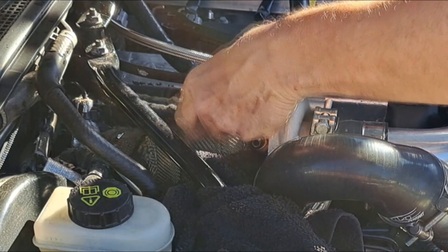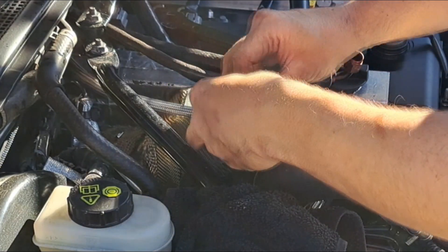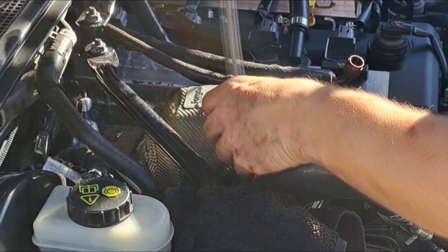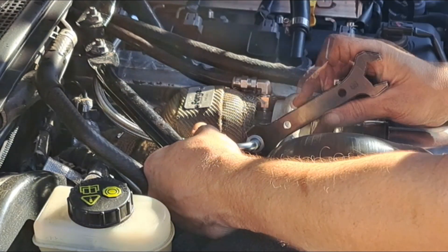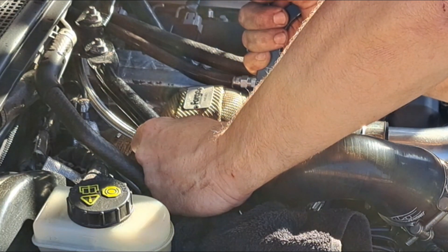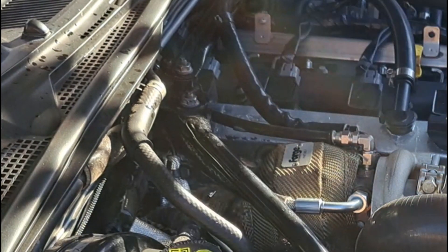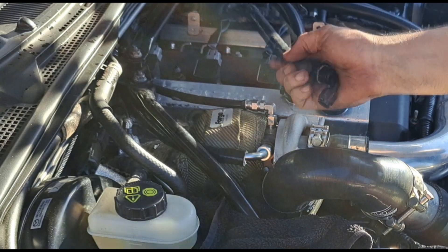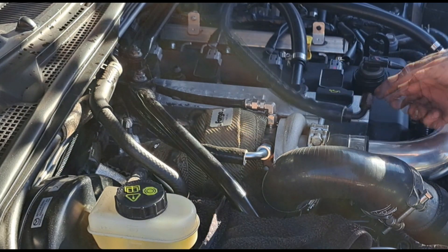Ally on ally means they don't scratch up as much. So what I'm going to do is put the new one on and that is going to set my length. Let's get this thread started - that's the right one, which is always positive. So I'm going to want that around about there. It's just a little bit lower to keep it away from that fitting. Now I've got the same to do on this one. So that's obviously the difference: these can swivel but there must be some kind of seal in there - an O-ring I've been told - and that's what failed, and that's what these new ones aren't.